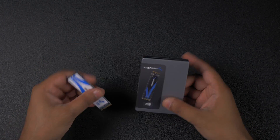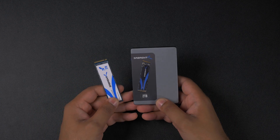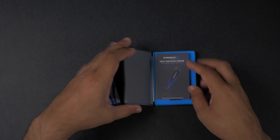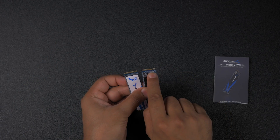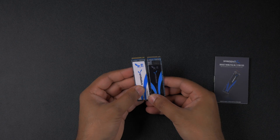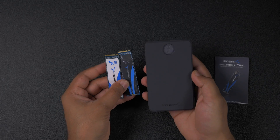Now to install the SSD, you need the right SSD. This one here is an NVMe M.2 SSD, not a SATA SSD. Both of these are firstly keyed correctly, so if you have a look, you need to make sure that the SSD itself has the notch just over here. And this will work perfectly with your NVMe SSD drive that we have over here.